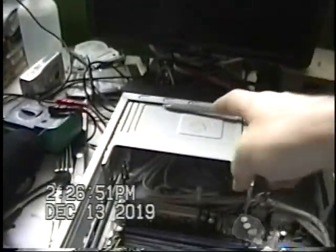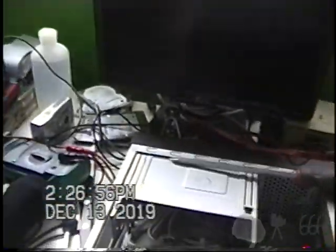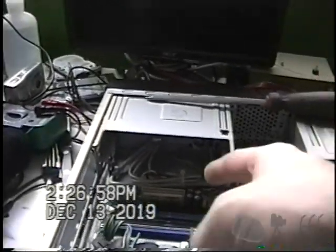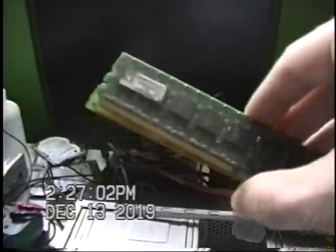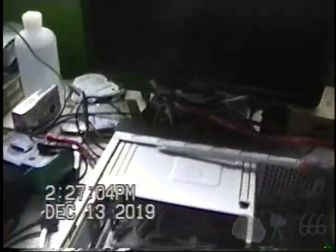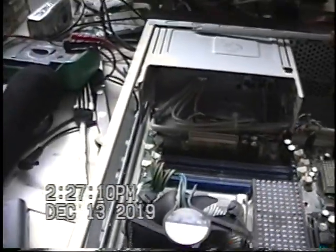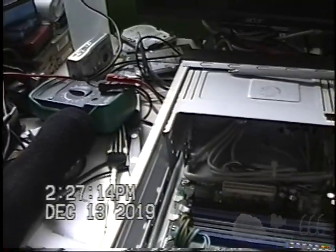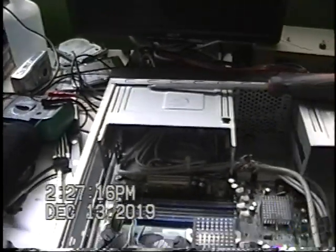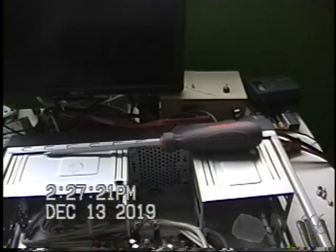So now I got to get the optical drive installed, and I know I need to do that because otherwise it won't let me into the BIOS setup. And then I'm going to get the RAM. I've got some RAM to install. It's only 2 gigs, but the existing machine only has 1 gig in it, so 2 gigs is an automatic upgrade anyway. I thought about putting a fan in the front. I don't think I'm going to bother. It shouldn't get too hot. And I think that's it, really. And it's just powering it up and getting the hard drive from the other machine.